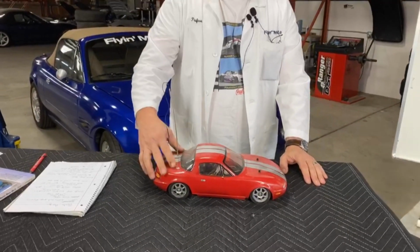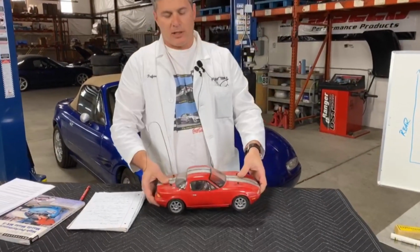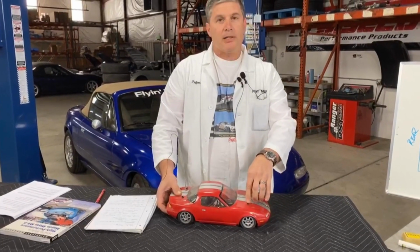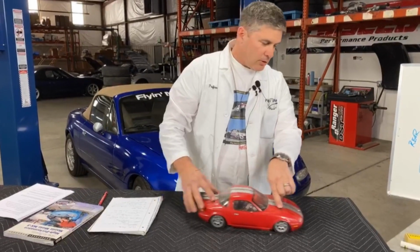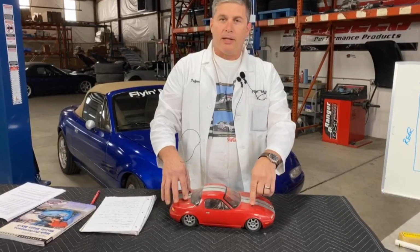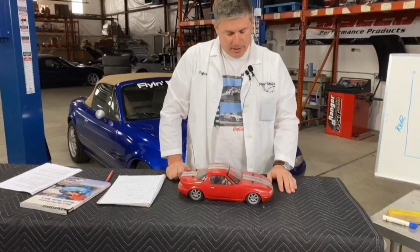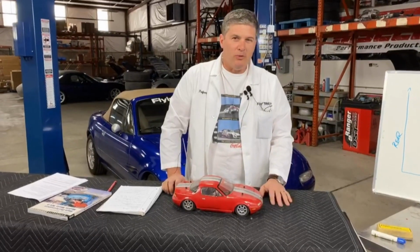If you have too much rear brake bias, you lock the back brakes and then you spin backwards and have an accident that damages the back of the car. If you have too much front bias, then you lock up the front brakes and you go straight into the thing that you're looking at and you damage the front of the car. We are looking to damage neither end of the car, so we want ideal proportioning. Now, ideal proportioning is tricky because it moves.